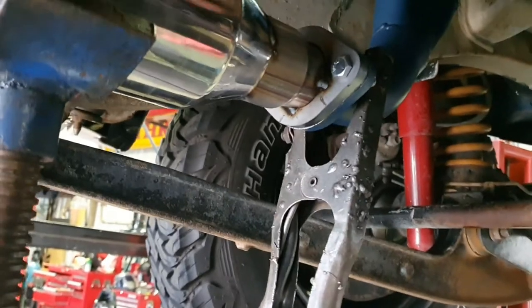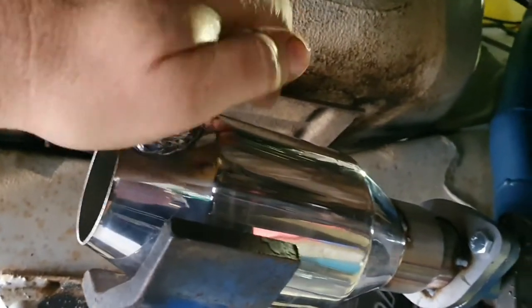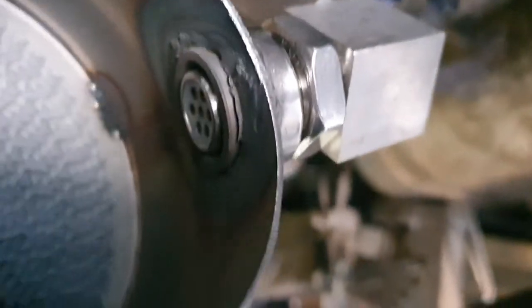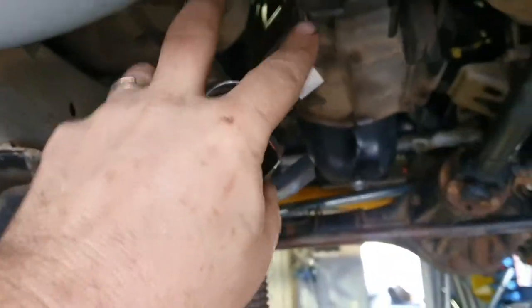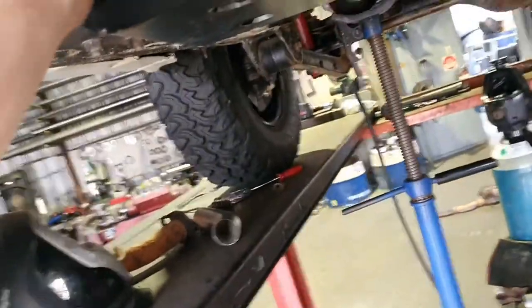At this stage we're just mocking up the cat converter. These two-inch outlets - we just stepped up to two and a quarter. And this is our little oxygen sensor adapter - this is what's going to stop the engine light coming on in this car. All it is, is a spacer that pulls it out of the stream, and on the inside of it those little holes contain catalyst material, so it sort of still does the sensing part as well. And then that's our 100-cell metallic high flow cat. We're going to come from this up through here on the original path, put a big flexi up underneath this splash plate here, and then flange her off at the back.